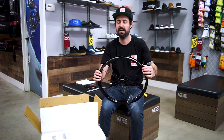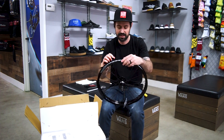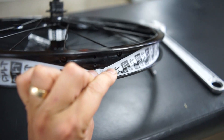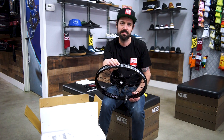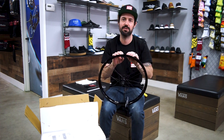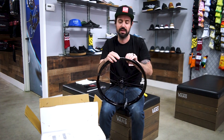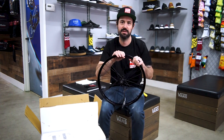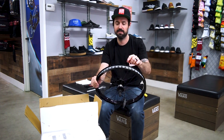The rim is made and then they have to put the rim together. The seam will always be located directly across from the valve stem hole, and you can see this one the seam is welded together as opposed to pinned. There are other ways they join them — sleeved rim, pinned rim, or a welded rim. Welded is the strongest way to make the joint, so Cult has these rims welded. They grind the weld smooth so it looks clean — you can't tell it was welded, but it will always be across from the valve stem hole.